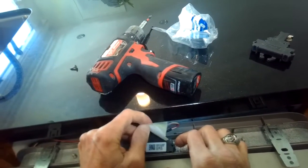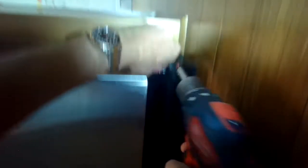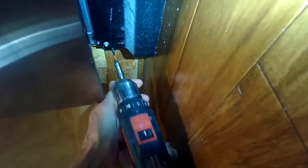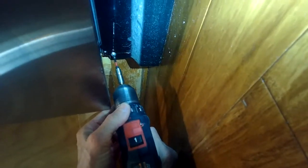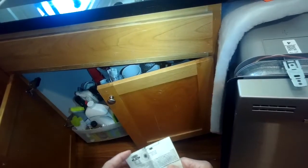That means the controller is defective, which is also fairly inexpensive. To get to the controller, unplug it and take out these two screws at the bottom on the kick panel, then pull the kick panel off. There's some insulation underneath — grab it and pull it toward you. The controller is right behind the door. I'm checking the wire that goes from the controller up to the door lock, making sure there are no obvious cuts — sometimes rodents can eat through the wire.